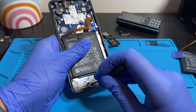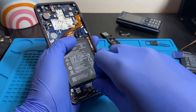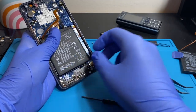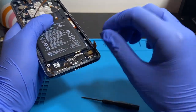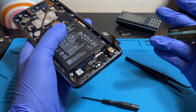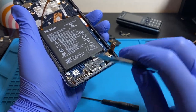I have to slowly peel it out. It's got one screw and a cable. It's a combo port with all of these connectors. Having a closer look, it is pasted really tight to the frame, which is really annoying. Nevertheless, we have to take it out to work on it because I'll be heating this thing pretty hard. As you can see, that's the display right there — we do not want too much heat next to the OLED display. So we have to take this thing out. I'm going to work under this with a metal spudger and slowly move up.